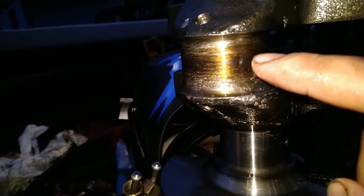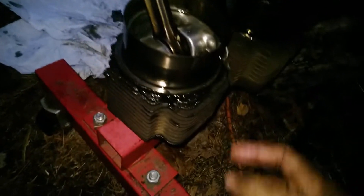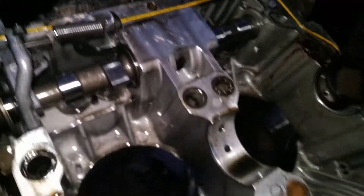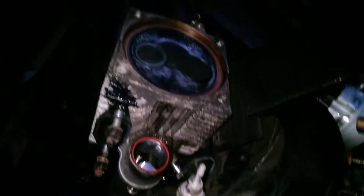Things we know we've got to do: this crankshaft is going to have to go to the machine shop. Let's see if it's salvageable because the mains are okay and the other rod is okay, but this one is very very not. I'm going to have to measure this rod to see if it's still in spec - if it's been ground down too much I'll have to replace it. Other than that, the cylinders are good, the pistons are good, I'll pop some new main bearings in, the camshaft's fine, and the lower half just needs to be cleaned of all this shrapnel. This engine's not that bad - just that one little thing and it should be good as new. And that injector - I'll take it out of the head and test it.